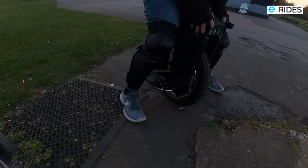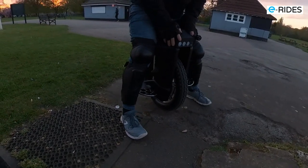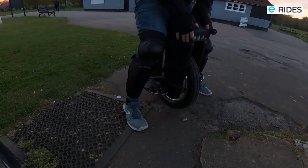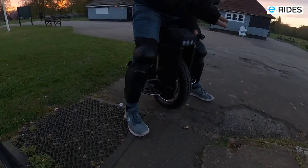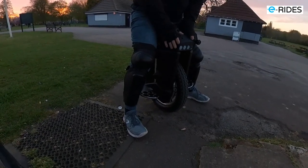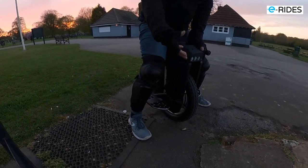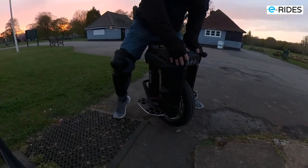The tire, I pumped up a bit harder, I pumped up to 34, to make it rounder, so it rides better. I know on the Sherman you have to pump it about 28, 29 to get that cushion feel, but when it's like that, it's quite flat, so you can feel the corner of the tire. But when this tire is hard, 34, you've got the suspension to make it soft, that cushion, so it rides great, it rides great.